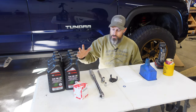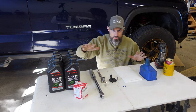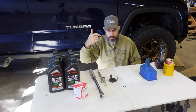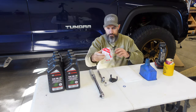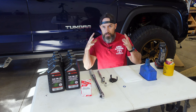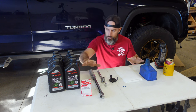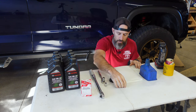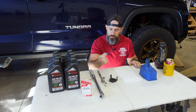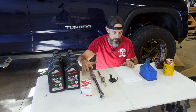Some of the things you're gonna need for this oil change: you're gonna need at least eight quarts of oil — this engine takes 7.7 quarts. I'll put the Toyota oil and a Mobil 1 option down in the description. You're also gonna need an oil filter. You could go to your auto parts store, or go right to your Toyota dealer. You'll need a 14 millimeter socket for the drain plug, a 12 millimeter socket for the skid plate, and a filter wrench. I'll put links to the gaskets in the description too.